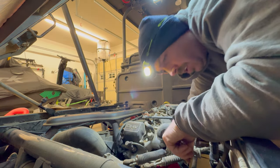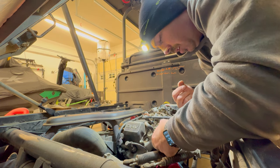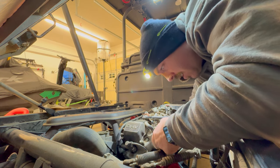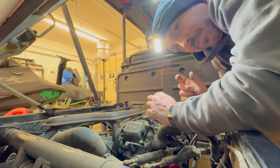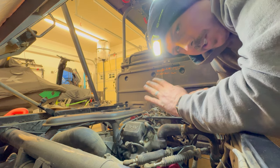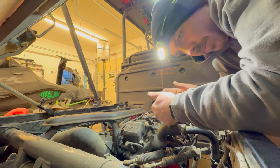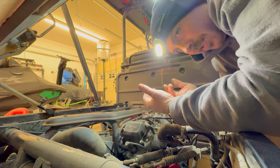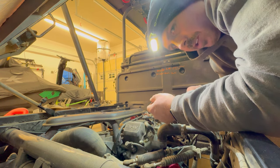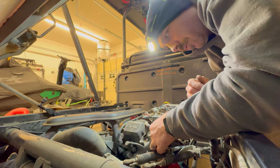One thing I didn't mention but did: look inside past the thermostat where it sits, make sure you don't have debris in there from all your scraping and cleaning. Try to get everything out — you want to see clean coolant. If needed, take a paper towel to absorb debris and push it out. It's always better to spill more coolant and get the debris out than to risk extra gunk floating around in your system.